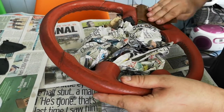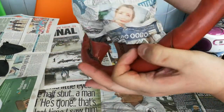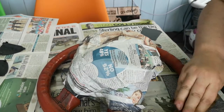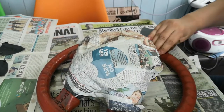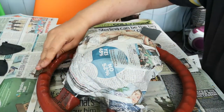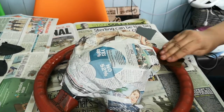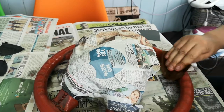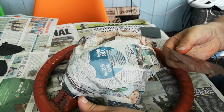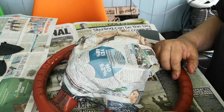I'll be able to confirm this in the next video, but I think if you're going to interchange — if interchange is indeed possible — you have to keep the smaller secondary connector when replacing a later airbag onto an earlier car. I'm not even certain you can swap an earlier airbag with a later car and vice versa, so I would try to find an airbag from the year of production your car is in. If you've got a 2000 car, find an airbag from the year 2000.